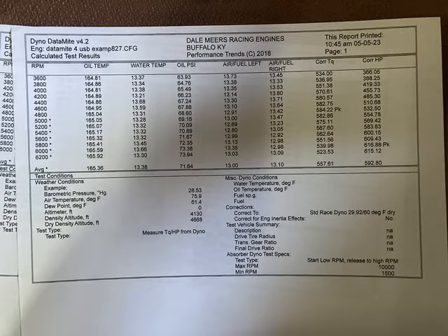Very mean-sounding FE for just 6,000 RPM — it accelerated really well and makes excellent horsepower. 617 horsepower at only 6,000 RPM with a dual plane intake and only 10.25:1 compression ratio. A testament to good induction parts, a good camshaft, and lots of torque — 584 pound-feet of torque.